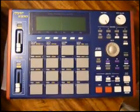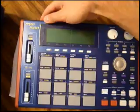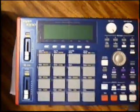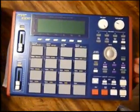Okay, before we get started, just wanted to point out a few things that you should be aware of. Never do this installation with your power cord in. In fact, you may even want to hit the power button to drain any sort of power out of the system prior to installing the hard drive, just to drain all the electric out of the system.